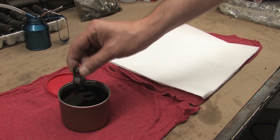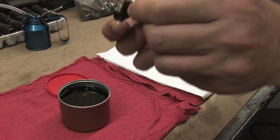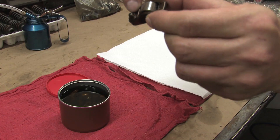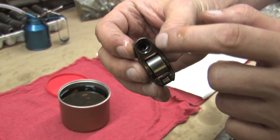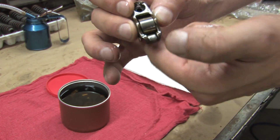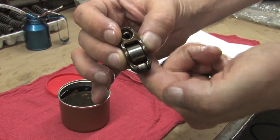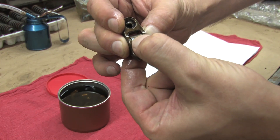It's a couple of weeks since I started this bath. The kerosene is nice and murky brown. You need to focus on four things when you're inspecting the rocker arm. First, the oil hole and the crown of the rocker arm — this thing loves to get clogged with debris, and the hole is tiny. The other side has the radius where the HLA seats and forces oil through it. You want to make sure the bearing spins freely and you can't feel any grit, and that there are no wear patterns on the bearing surface, and no play in the needle bearings.